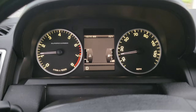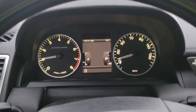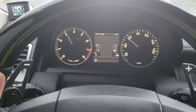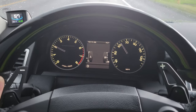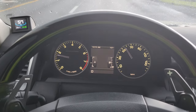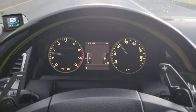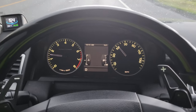We're back in the car and taking a test drive. I don't necessarily have 100% confidence in this because we did counterbalance, and that sometimes works and sometimes doesn't. We're going to find out right now. Well, look at that — there is no shake. Wow, that actually worked! Even counterbalancing — that's unbelievable. I feel a very tiny amount, hardly nothing, and it feels like it's from the road, but way better than it was. I'm pretty impressed. For $80, you really can't go wrong. The reality is, I think I just won. For those of you dealing with this headache and these guys can't get your wheels right, you can do it yourself for $80 plus whatever the weights are.